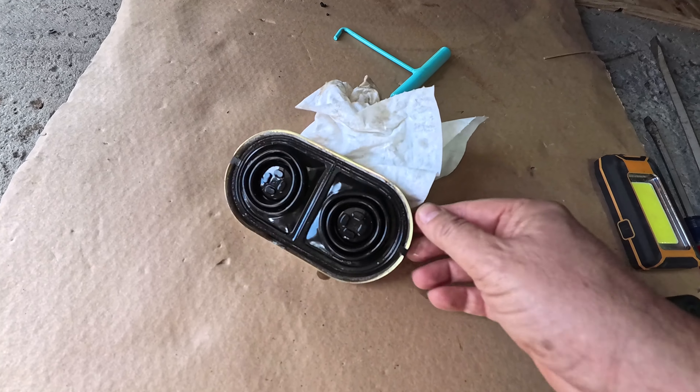Once I start bleeding them, this is going to go down and I'll have to add more. This is the old brake fluid — I put it in this bottle because the hose has to be submerged in old fluid, or it could be new fluid. That way, when you use the one-man system, any air bubbles that go in will get trapped in there. I'm going to start flushing with the wheel that is furthest from the master cylinder. The master cylinder is kind of under the steering wheel, so this one is the furthest and we do it first. The second furthest is the one on the left-hand side in the back. The third will be the front passenger side, and you always do last the one closest to your master cylinder.